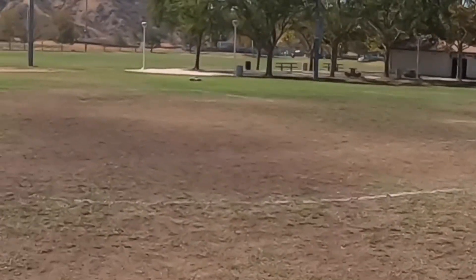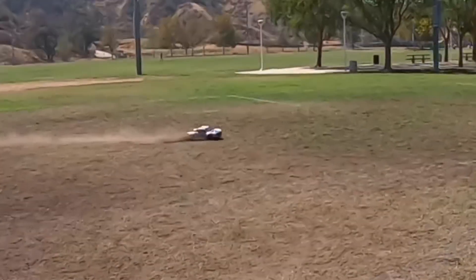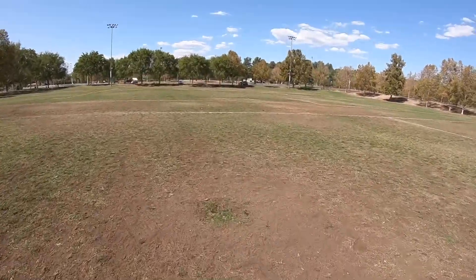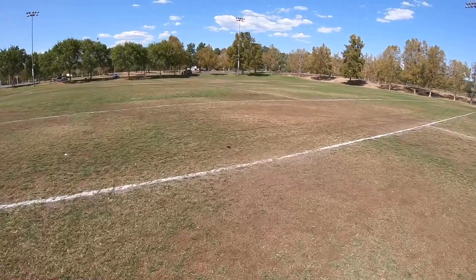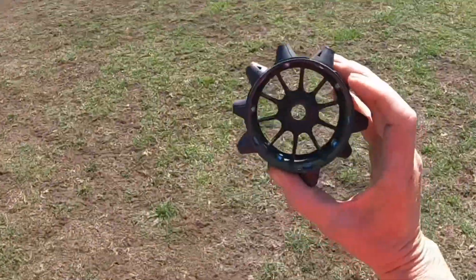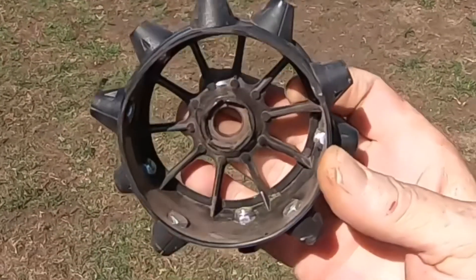It got a little squirrely. It looks like a wheel came off. In that run it turned right really quick. I have a feeling it probably stripped out the hex, because cheap wheels tend to do that and the Mojave loves stripping out the rear hexes, especially on big drives. The washer looks like it's still in the rim — and yes, it's stripped out the hex. So this wheel is no good now. You can see the wheel hex is all rounded out. What happens is it strips it and then it unscrews it.